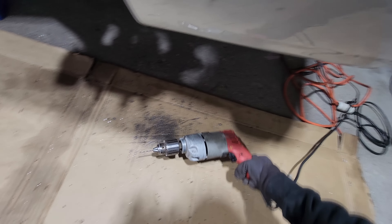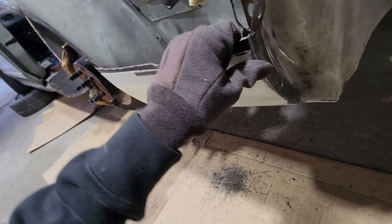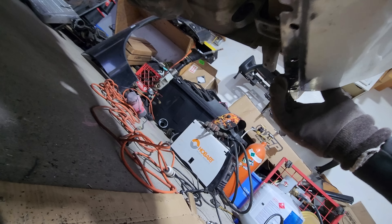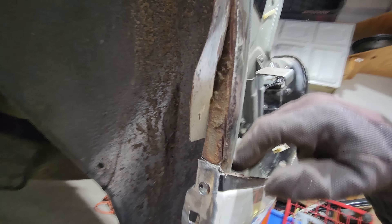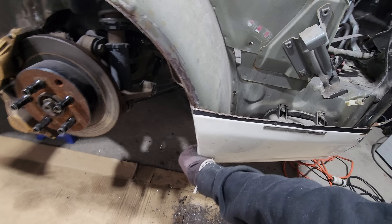We have all the spot welds drilled out on the very last piece of the quarter panel. Before I take this off, I'm not going to make the same mistake I did last time - we're going to start trying to peel back some of these panels to make sure they're free. Did I miss one right here? It's like stuck on this seam that I grinded. The bottom ones are good to go. Looks like there is a spot weld right here. I'm replacing this anyway, so I'm not really concerned about the condition - I'm just going to go ahead and force it.